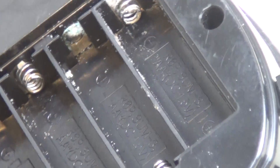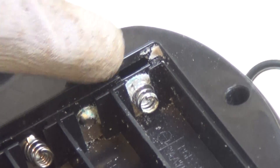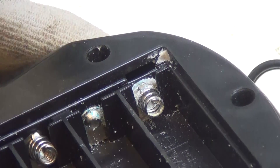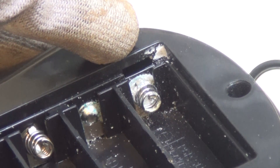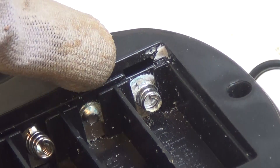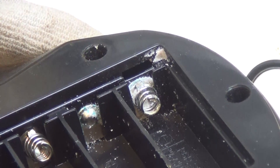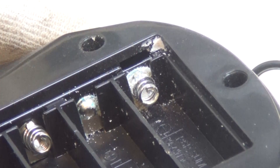I paid full Goodwill price for this, but maybe I can get it cleaned up. It's likely you can just take a toothbrush and brush this corrosion, maybe even sandpaper the connections, and it will actually work. But the problem is, once you have battery corrosion like this, even if you clean it off, it could still continue to corrode on its own — the acid is still there and could keep eating your terminals and even start eating into the wires inside the controller.